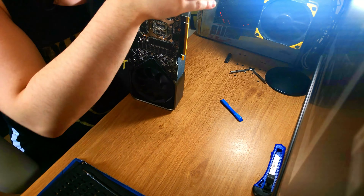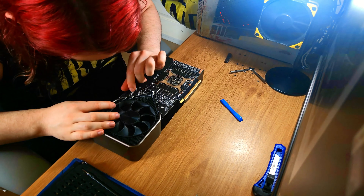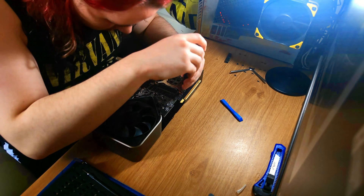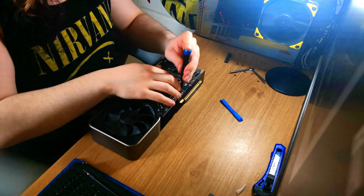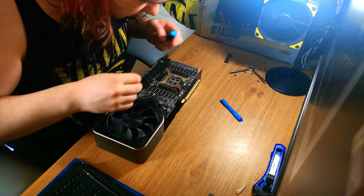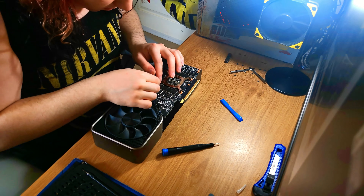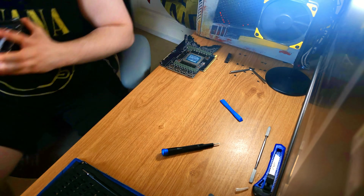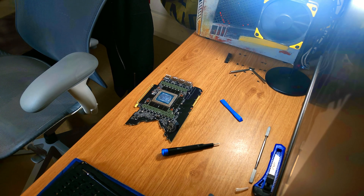What we're doing in this part is adding shunt resistors. What are shunt resistors and why should you care? If you like the pursuit of speed, you're going to want to overclock your stuff. To have a stable overclock you need enough power, and if you don't have enough power or it's too hot, you won't get a stable speed. However, if you can increase the power and make it run cooler, you can potentially push it further, up to the actual instability point of the die itself.